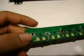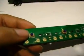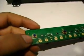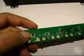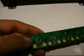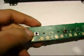And I also found out later, when I looked through the AC controllers, that those are the same lights that are used in there. The only reason I'm pointing this out is because after a while the socket gets separated from the solder point. That explains why, when you tap on the AC controllers, the lights sometimes come back, basically because you shake the socket and it touches the solder point again.